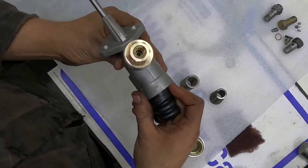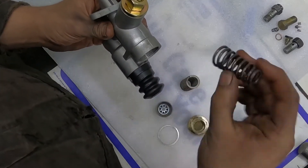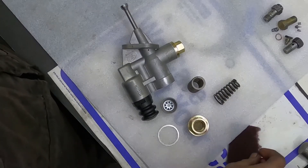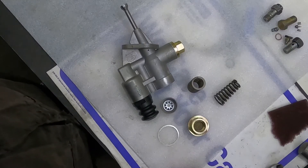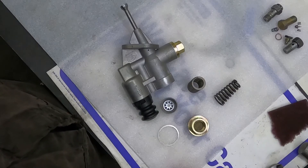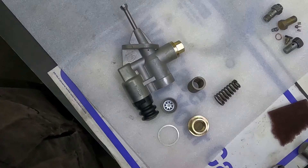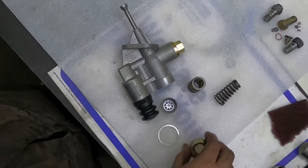You can do it on the engine. You unthread this, pull the old spring out, put this spring in — obviously you've got to have the plunger in there. Basically, what this will do for you is it ups the pressure going to the pump. If you want to make 400 to low 500s horsepower, this is more than sufficient. You don't have to have an electric pump — it does the job. I personally would upgrade the filtering myself, but that's completely up to you. As long as you're changing your fuel filters all the time, you don't have to.